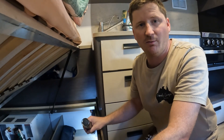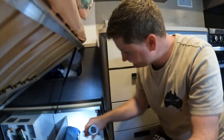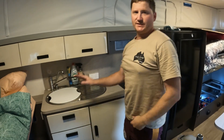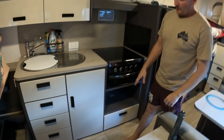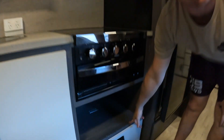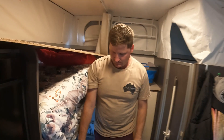Under the beds is where the wiring comes up from underneath — where I jumped into the original factory wiring under the van. These two red wires are the ones I've run coming up from underneath, and they run along the bottom of the van all the way to the back. Those wires run under the cabinetry hallway from the front to the back. Just tuck it along and work your way down following the factory wiring. If the microwave's out it makes it really easy — there's a little split in the back to run it across, then under the fridge and into the back.